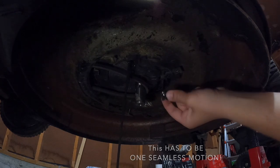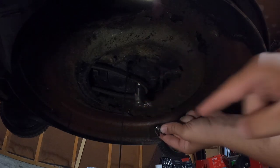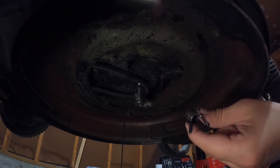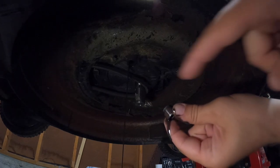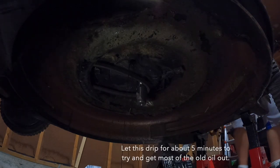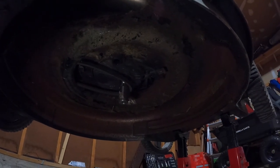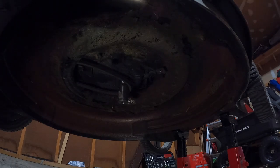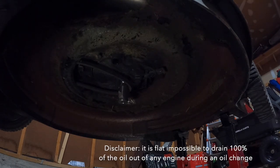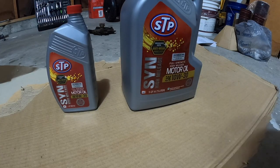You can see this is very old crummy blue-green oil — that's old bad oil right there on my hand. Let's clean this up with a paper towel. You're not going to get 100% of it out — you may get 95 to 98% — but you will never drain out 100% of the oil, whether it's a car, lawnmower, or diesel truck.